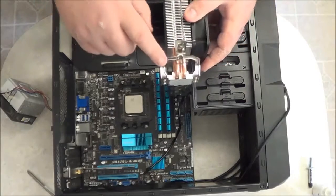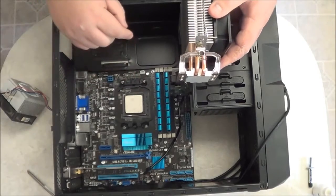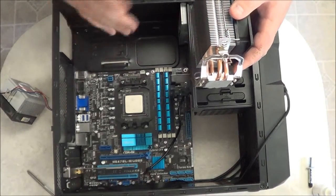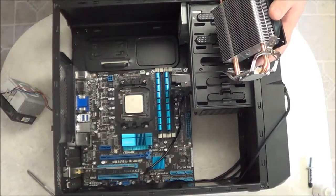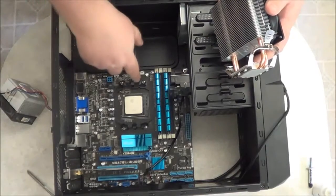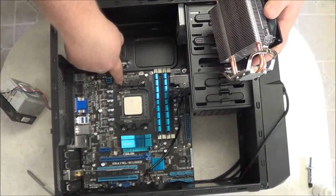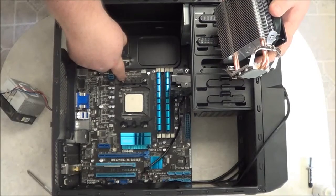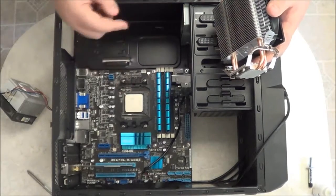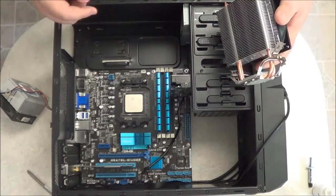The reason for that is because this AMD heat sink just has a latch — you latch it over the nipples on the ends of the socket. Whereas a lot of Intel processors actually screw into a frame. The mounting frame uses four screws, and if you look at an Intel motherboard, you'll notice the mounting holes are further out across the board. So there's a huge difference between heat sinks for AMD and heat sinks for Intel — it comes down to how they're mounted.